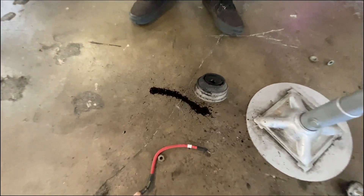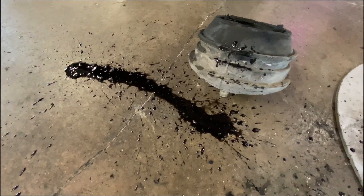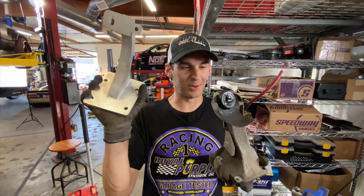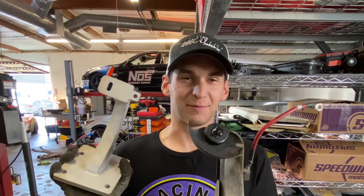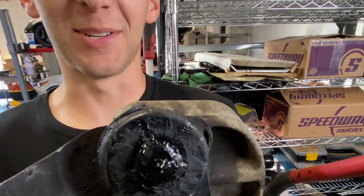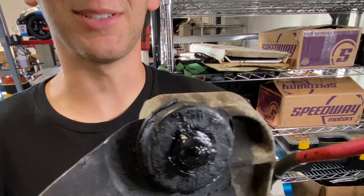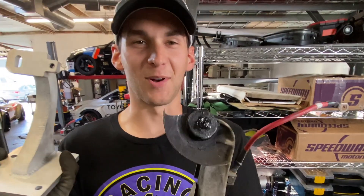Wait — are they liquid-filled? No way. That's why the bottom of this thing is so dirty. Old versus new — this thing is looking fairly beat. I'm pretty sure that's what that clunk noise was that I couldn't figure out for a while. Every time I'd make a turn and hit the gas hard it'd go clunk. I'm going to go right ahead and say it's that motor mount being torn in half.